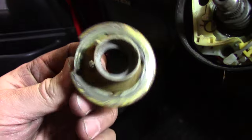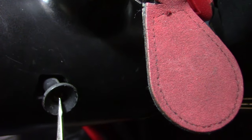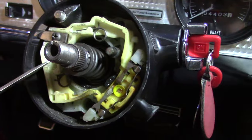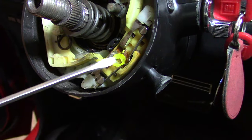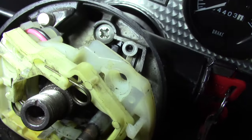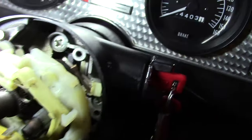This just turns with the wheel I believe. I'm going to take this screw out for the turn signal switch and then the screw for the hazard switch button, and maybe a couple of these other ones, to see if I can get the turn signal switch out. There's some kind of keeper just laying in here — don't know what that's about. I got it pulled out a little ways. There are some wires on the back side of this, so I'm not going to mess with that, but I can see the ignition cylinder and the retention clip that holds it in there.